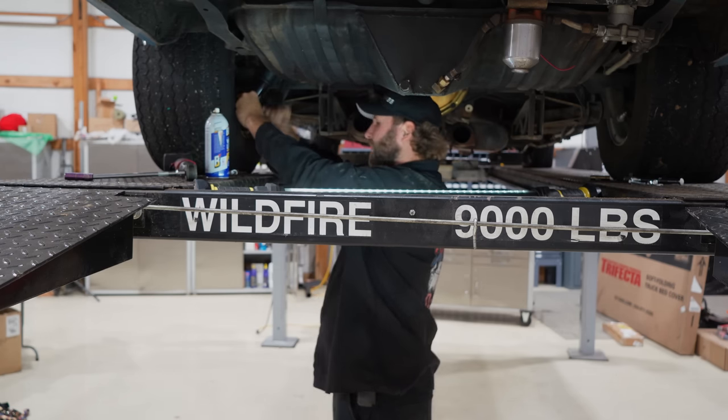Okay, speaking of corn, that has nothing to do with the next subject, tires. These Mickey Thompson Sportsmen's, what are they? SS's, probably, looks like it from the tread pattern. Dry rotted, super old tubes, not gonna work. I'm gonna bust those off and we're gonna put on the Billet Specialties, and I believe they're Hoosier radials that I used on Independence last year on Sick Week, and we'll use those on the rollers. I know they're good, it's good rubber. They have less chance of coming apart.